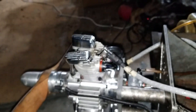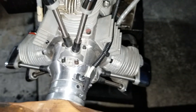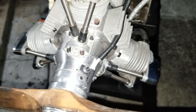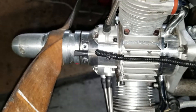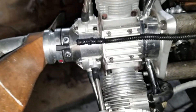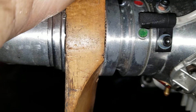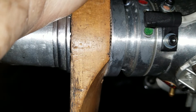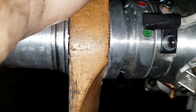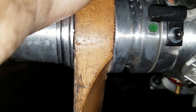I do not know the reason why they choose to do the timing this way — they might have a reason which I might not know. According to the CDI specification, like I said, it needs to be done 30 degrees before top dead center when cylinder number one gets under the magnet. Static timing is supposed to be 30 degrees before top dead center. I'm stressing this so make sure everybody understands: it's supposed to be right here — 30 degrees. If you have the timing kit device, right here.